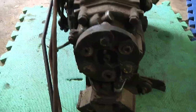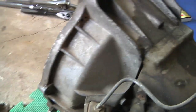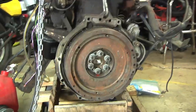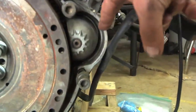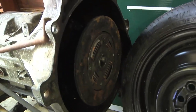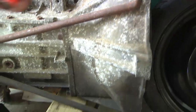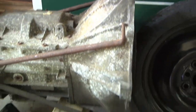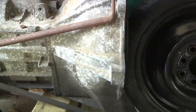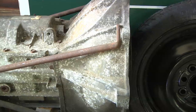That rag joint doesn't look like the best thing to bolt an electric motor to. What I was most interested in is the actual bell housing itself — I think it was about five and a half inches, but the bell housing is the right match: it lines up with all the holes and has a little bump out for the starter. If we look at the Chevy S10 transmission, the spot for the starter is on the wrong side and it's about an inch thicker. So I'm wondering if I take the bell housing off the Mercedes and do a bell housing swap — the Mercedes one should be about an inch shorter, giving me up to an inch to play with for spacers to make everything connect right.